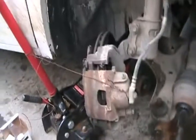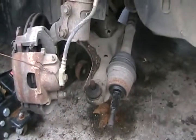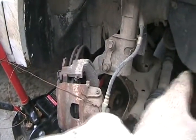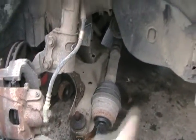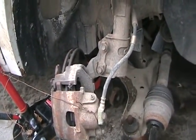Got the axle out of the way. I've turned the steering wheel and tied a piece of mechanic's wire to my jack to keep everything out of the way. A loose ball joint is always a bad ball joint. You definitely want to change them before it's too late, because you could be driving down the highway, hit a pothole, it completely separates, your whole spindle assembly moves that way all by itself with the tire attached, gets jammed under the fender, buggers the fender up, catches on your door and wrecks it, rips your axle apart or pulls out of the transmission, you lose all your oil, can break the housing of your transmission, and can suck you into oncoming traffic, into the ditch, or even cause you to roll over.